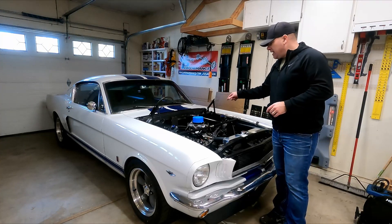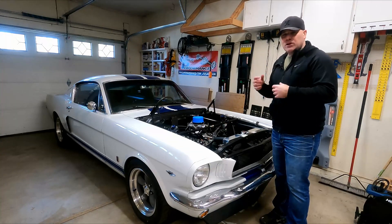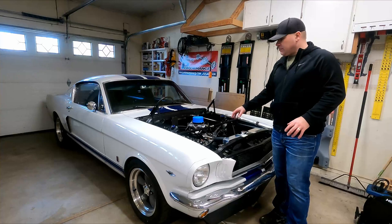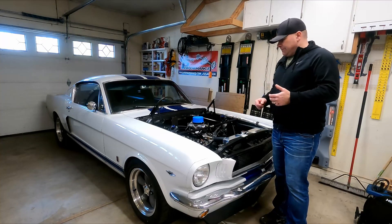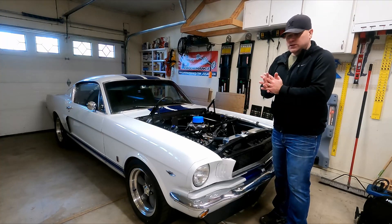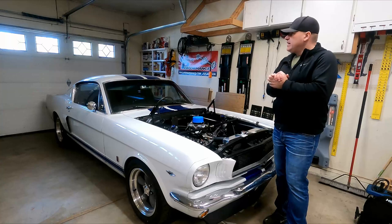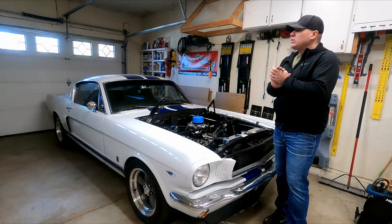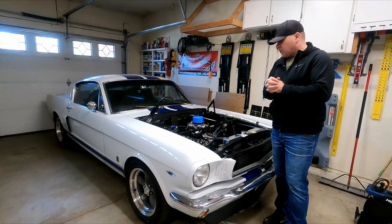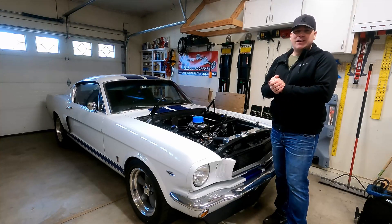Also on cylinder number four and number eight, I had to go back and turn the distributor because I kind of get in that rhythm and forgot to turn it. I was able to catch those up and get them done, but just be careful — if you lose concentration on what you're doing, you could be adjusting stuff and it may not be exactly how you want it. Anyway, I've got to slap the valve covers back on here and I'm going to go out for a drive. It's still pretty cold here this weekend but the weather should hold up. If you like the video give me a thumbs up, and if you subscribe I appreciate it because it helps my channel out — we'll see you in the next one.